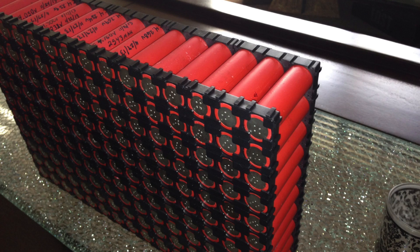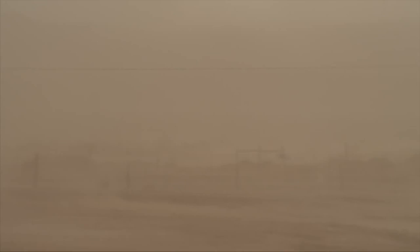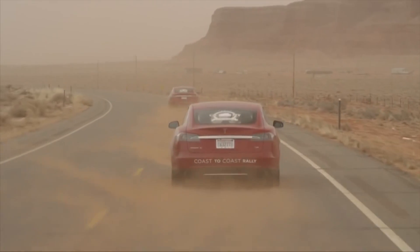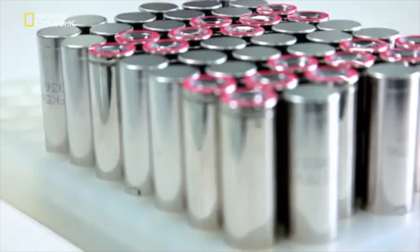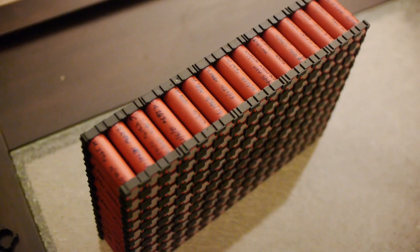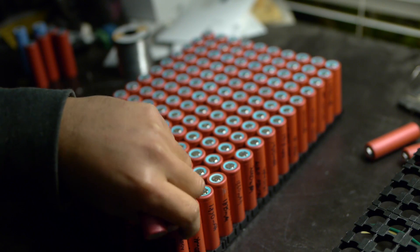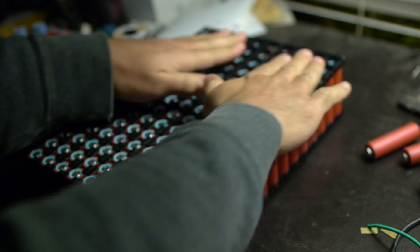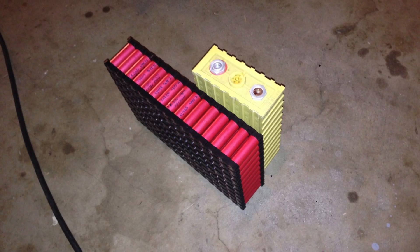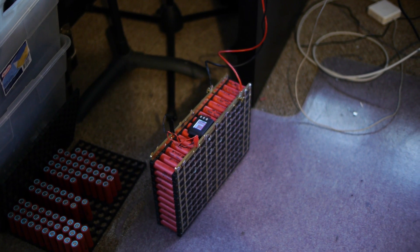So the alternative is to look at another chemistry, like the one used on the best electric car to date. That would be lithium cobalt cells used by Tesla, first on the Roadster and now on the Model S. They use mass-produced cylindrical 18650 cells commonly found in cordless power tools and laptop batteries. They are small in size, very light, and very powerful. Cost is about the same as lithium iron phosphate, but the advantage of lithium cobalt is that it comes in about half the weight and size, allowing my Samba to go further using a battery roughly the same physical size and weight as the current one.